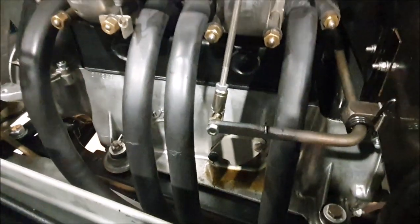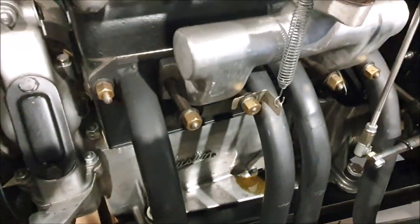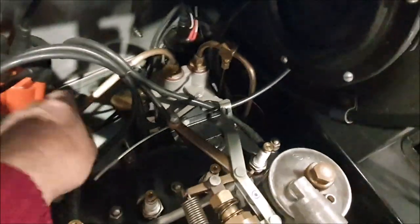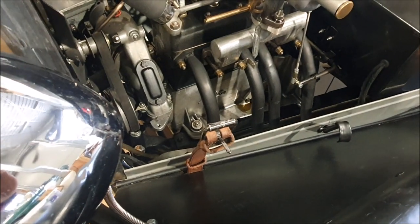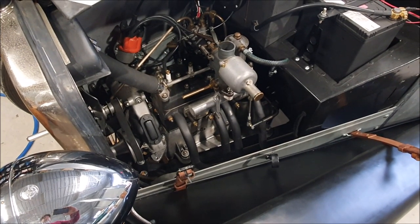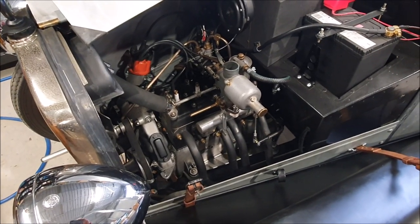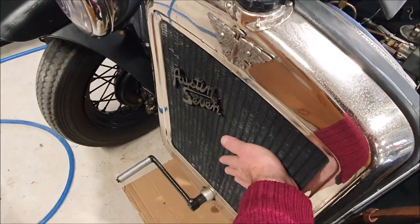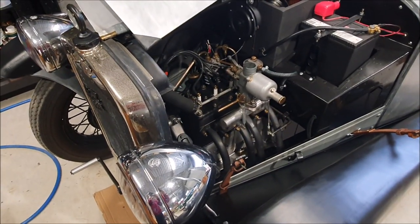I think that's oil actually - possibly from the dashpot - and it's leaking a lot of oil down from the valve cover, so that probably needs tightening. The oil piping all looks good and the oil filter definitely had good oil pressure, so that's no problem. Obviously good pressure if it's leaking it out. But yeah, a bit more tweaking on the carb I think to get it running. It proved that everything's running enough to get it on the road I hope. It's fairly hot but not burning hot - it was successful, just a bit more tweaking of the tuning.